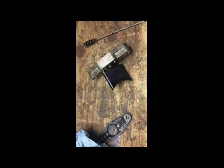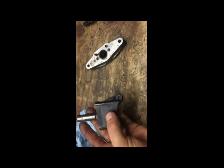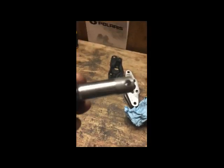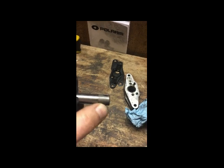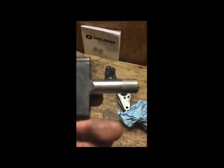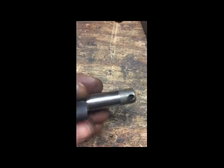I got this drill here, half-inch chuck. I'm going to chuck it up in there and smooth it out and polish it. Don't groove it — you want to be even; you're trying to make this thing true again. You could bring it to a machine shop or buy a new one, but this is a fix for now. I chucked this up but couldn't get the chuck all the way down — maybe a drill press with a bigger chuck would let you get to that one little section. So I'm going to end up having to manually do this. That took out that wave in there, so I'm going to manually take the sandpaper over this, get it smooth, and get the transition nice on that.